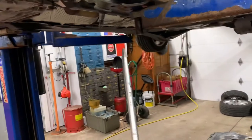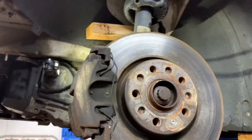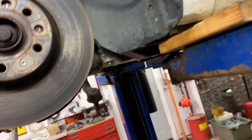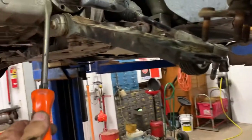Driver's side: get that piece of wood out of there. Stick a flat-blade screwdriver inside here so you can pull against the rotor and the block falls out. Now you need to add your ball joint to your control arm.